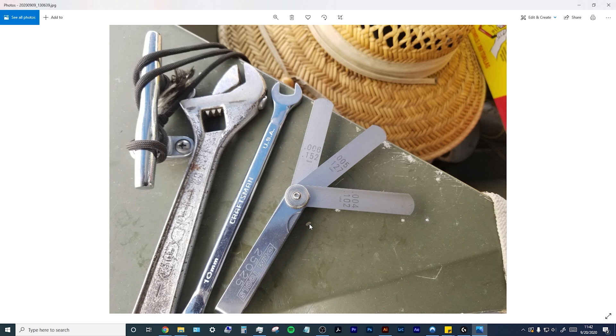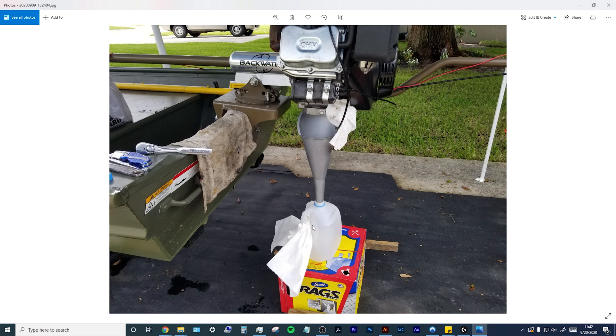After adjusting the valves, I didn't have to adjust anything — they were actually perfect. I did an oil change. I had a funny rig set up to get the engine sitting level and set up my oil catch with plenty of rags. It ended up being very clean. I drained the oil, put new oil in, checked the spark plug, checked the air filter — did all that fun stuff. So it has new oil, new spark plug, valve lash is great. The only other thing I could do is a compression test, but I don't have that tool. So I'm going to go out, run the engine, play with it, see if the vibration got any better, then put the swamp burner back on. If the vibration isn't there, I can narrow it down to say it was more or less the backwater kit rather than the engine.